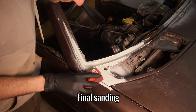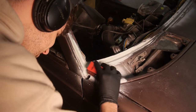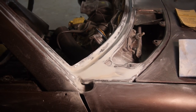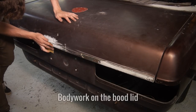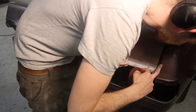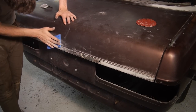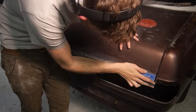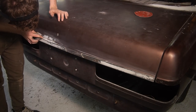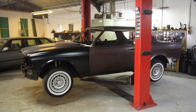With those two ticked off, I can now sand down the filler and have it ready for Bobby's final touches. The same went for the boot lid — for some reason this area suffered quite a bit of surface rust, most of which was dealt with off camera. The whole car now needs DA'ing with 320 grit as well as a few final touches and it will be ready to paint next episode. Once it's painted, it's simply a case of putting it all back together again, bar a few little problems that we'll sort out once we get there.